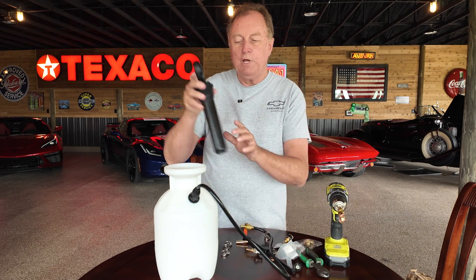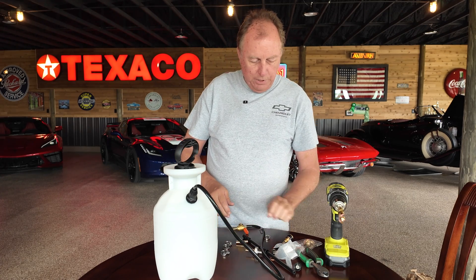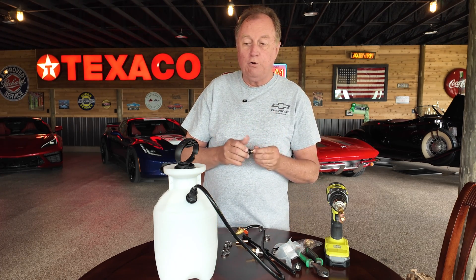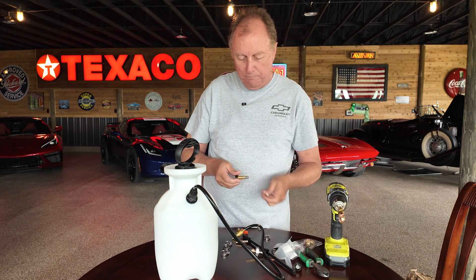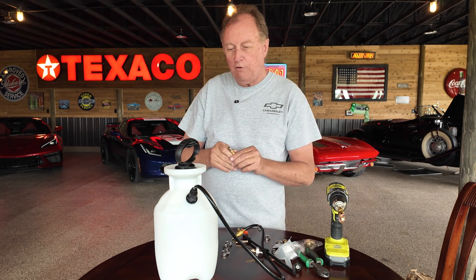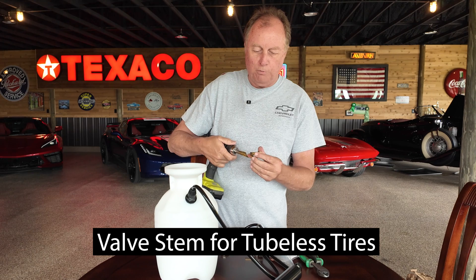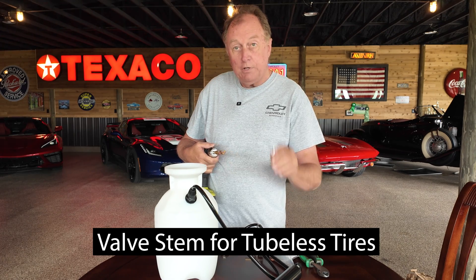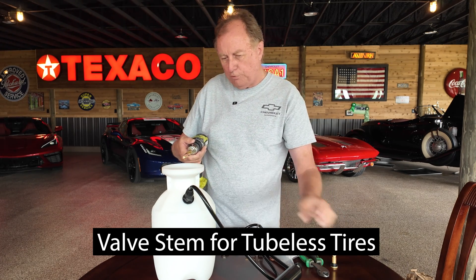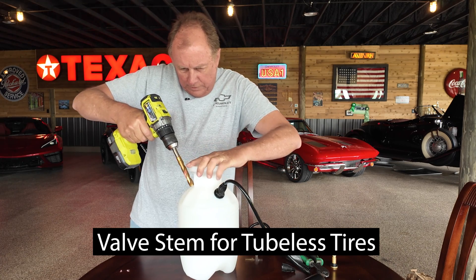If we wanted to stop there, all we'd have to do is put the pump in, pump it up, and it's going to allow us to flow fluid up through our ball valve into the engine and prime it. But I can't leave good enough alone — I don't want to be pumping this thing consistently. This canister will hold, by manufacturer specs, 60 pounds of air. So I'm going to put a check valve in on this. You're going to have to look and see what size drill bit your check valve requires. I'm going to drill a hole in here and get the check valve put in from the inside and bolted. I just need to pick a spot that I can reach, and we're going to drill a hole.